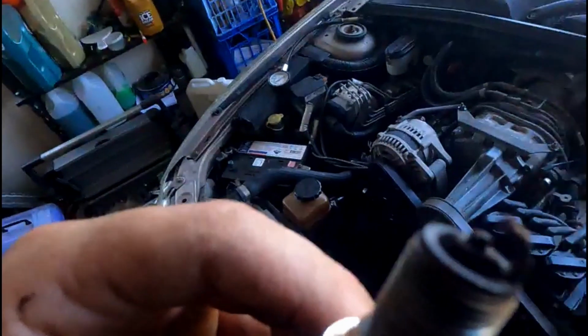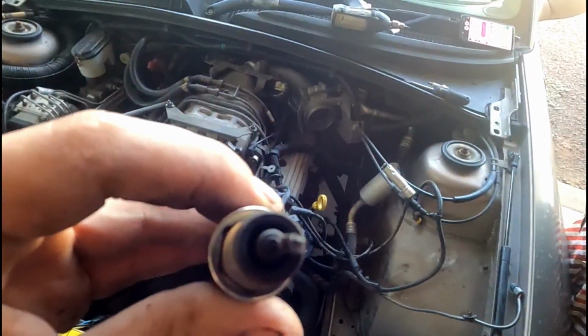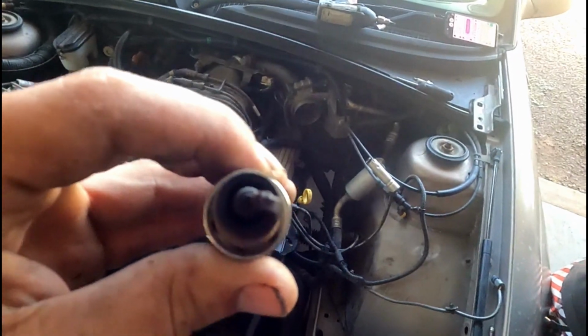Well, it's firing really hot in the combustion cylinder. It's melted the top of this one too. Like, look at that. You shouldn't be able to see that electrode down there straight from the top. I knew it was misfiring on at least 3 cylinders, we just didn't know it was all 5, 6. Yeah, she's definitely time for a rebuild.